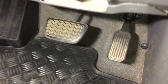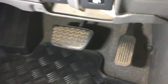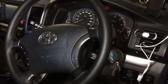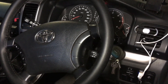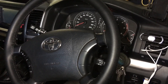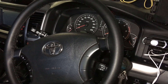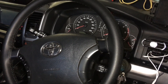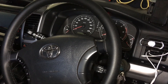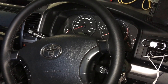In the other vehicle — our 2008 120 Prado — we've just got the Autofix, permanently plugged in. It just stays plugged in and anytime we like, if we want to read any data or if we've got an engine light — this vehicle does get the P0400 code, so it's got some sort of EGR flow issue there. We're still working on that; we haven't had time to do a final check on a couple of components. Don't go replacing your EGR valve just because you've got a P0400 low EGR flow — it doesn't mean there's something wrong with the EGR valve.